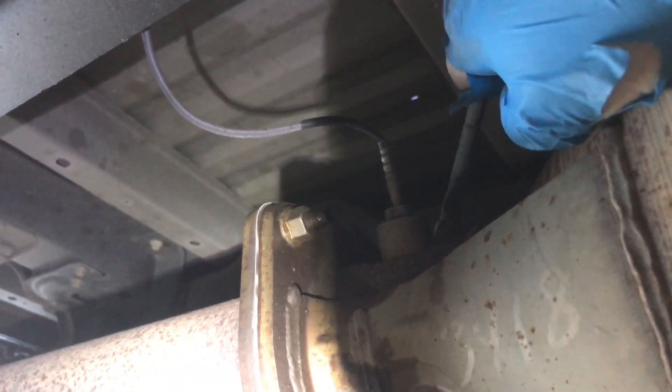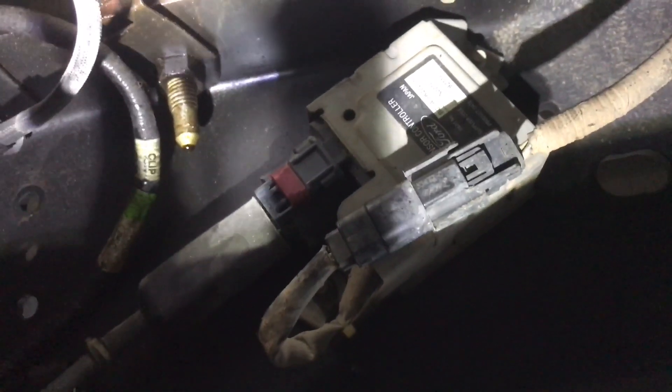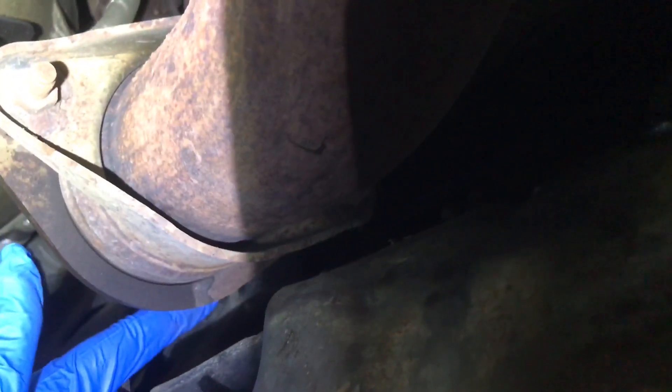Hopefully that makes it a little bit easier for you guys. All the way to the back there's one more sensor and then this gigantic O2 sensor. We'll chase this up on the frame - it looks like a black part is holding that O2 sensor so you might have to deal with that to disconnect it. This O2 sensor is pretty big with a red piece on it - you'll end up needing a screwdriver to push it back as far as you can, then push down and pull it out. Now we're going to be taking off the exhaust. This is not the side you take off - you need to take it off from the front. There's a bolt here and a bolt on the other side - 13-millimeter - and from what I've read there's a hole in the frame to use an extension to get the one on that far side off.